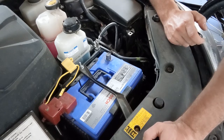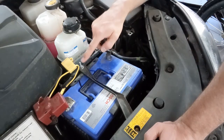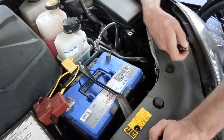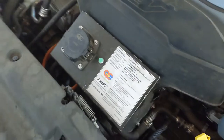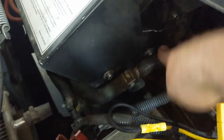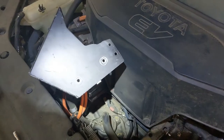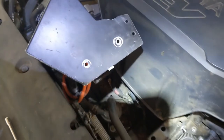Next, remove the 12-volt battery: unbolt the positive terminal, loosen the nuts, pull out the bracket, and pull out the battery. Then remove the aftermarket fast-charging component installed by the previous owner. Remove the two bolts, but the hose is in the way so remove that first — it's bolted down in the back. There are also three bolts on the other side to remove. The fast charging component is now unbolted — torque was 5 foot-pounds for all five bolts.